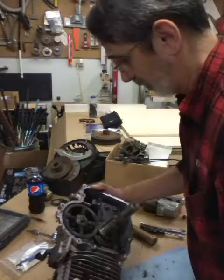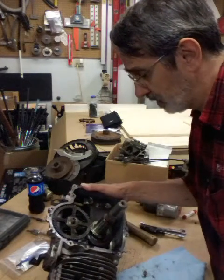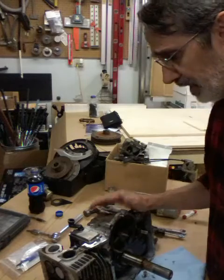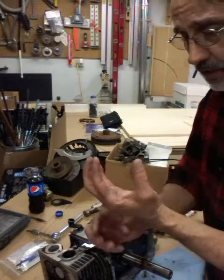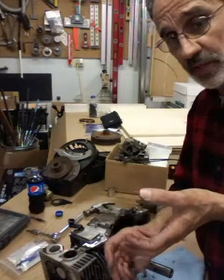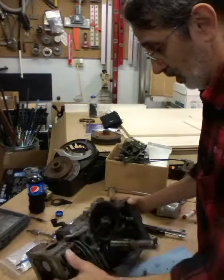The inside looks pretty good. I was really concerned about the bolts in the connecting rod — I've had a lot of these things blow up because the bolts come loose, and this one doesn't seem to have a keeper on them either to keep them from coming loose. When I get the rod and piston out, I'll show you what it looks like. Most engines that have been failing have the rod coming straight down in a half-U shape. This one is almost at 90 degrees — the cap goes this way and the rod goes down. That would be a lot less stress on the bolts. It's a much better design in this engine, probably because it's bigger horsepower.